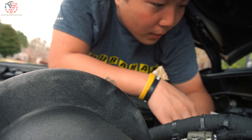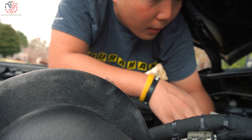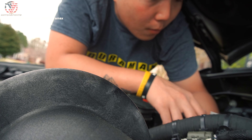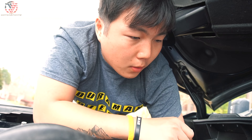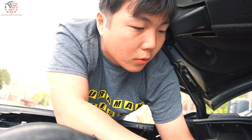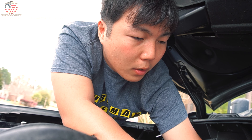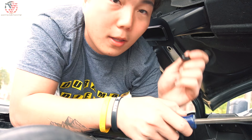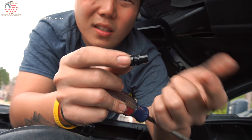Technically both of my trucks are down at the moment, but this is a really simple fix so I'm thankful for that. One thing I like about having issues with the truck is I get to learn. This is a very common issue on the L5P Duramaxes when you do the delete. I reached out to Holden and the same thing happened to his truck, which made me feel better — it wasn't just me. He ordered one of those heavier duty plugs for his L5P. Look at that — it just tore up. It's so thin and cheap.